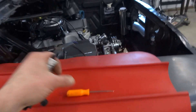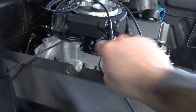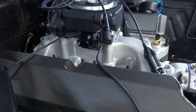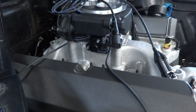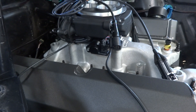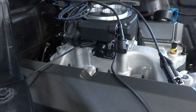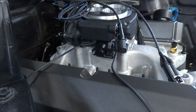A Holley Sniper has a throttle position sensor on it, and the Baumann US Shift controller needs a TPS signal. The Holley Sniper also needs its TPS signal. You will hear nightmares all over the internet: don't do it, can't do it, can't piggyback off Holley's TPS, et cetera. I've seen it go both ways.